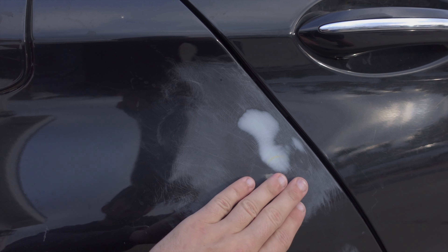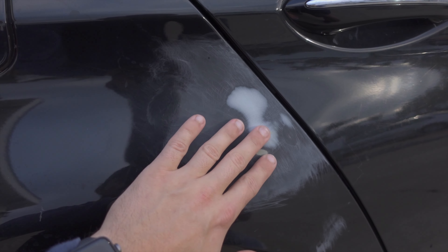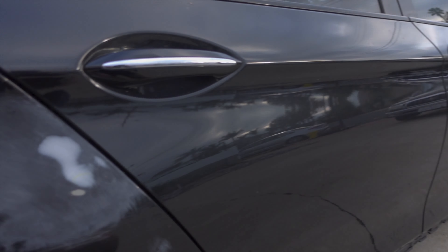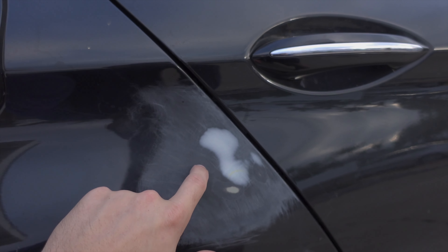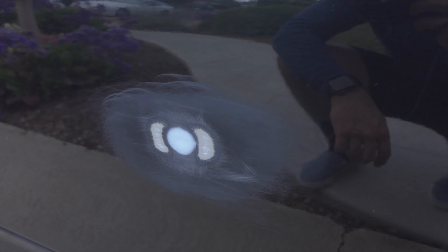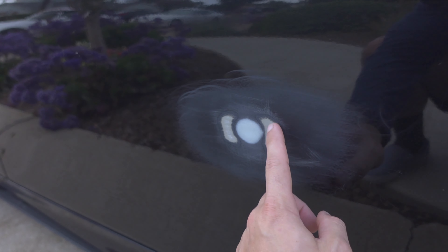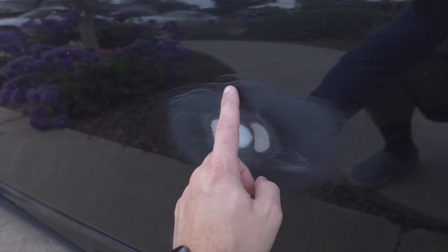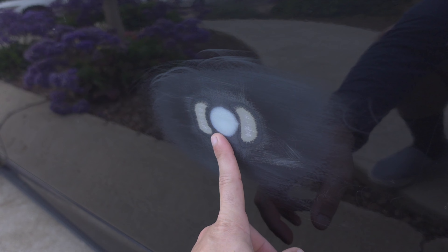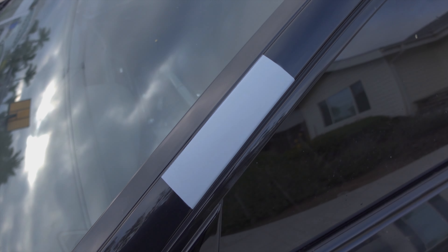As for the spot near the fuel door — I went over it with 2000 grit. Truthfully there are almost a few low spots right there, but they're hardly noticeable. I'm not going to bother trying to redo it to perfection — this is perfectly fine, so I think we can officially call this spot checked off. Moving over to the driver's front door — this one ended up coming out pretty good. You can't even really tell. The problem area was right here and I almost went all the way to metal, but I feathered it out pretty far. It's pretty smooth, so I don't think we'll have any problems wrapping over this — the driver's front door is checked off.